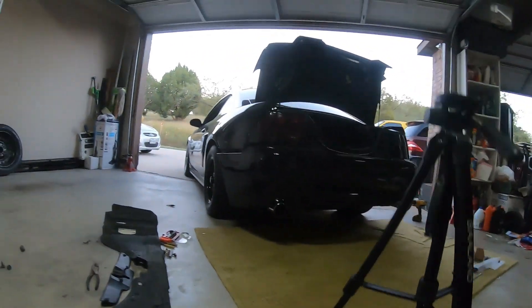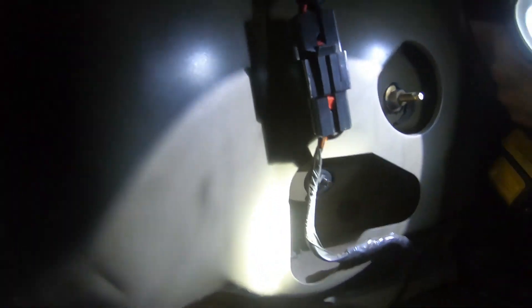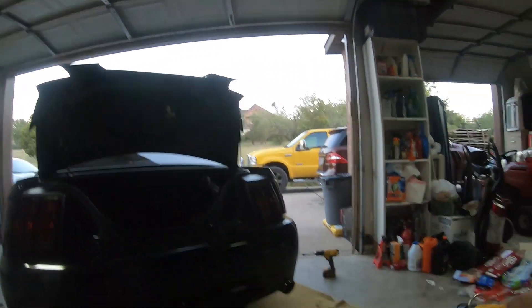So what we're going to do is I've already loosened the side right here and the other side. Now we got to take off three washers that are over here. There's one right here — I think y'all can see it. Right there. And there's one over here. Those three — take those three off and then the bumper should come off. Let me get back to y'all.